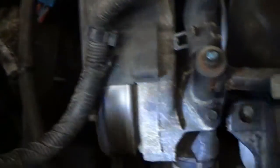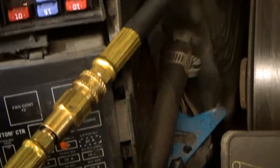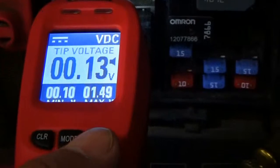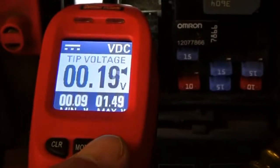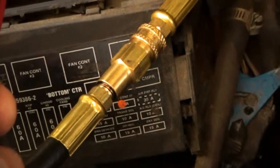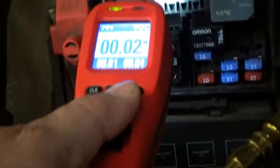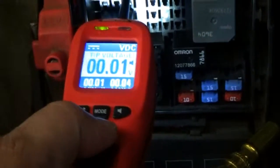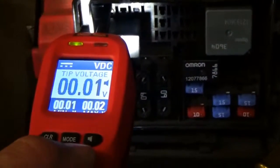Here you can see I got battery voltage at 12.32 volts. Here is the prime for the pump — that is reading that — but if I put the switch on, this should come to 12 volts. That is the prime for the pump. On top, that is the one that you can energize to get the pump running, and on the other side you've got ground.